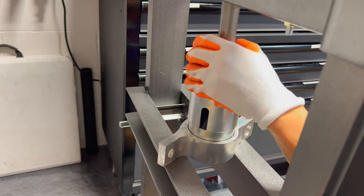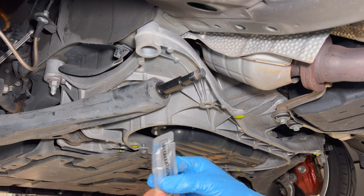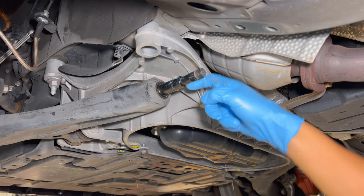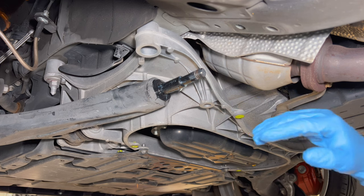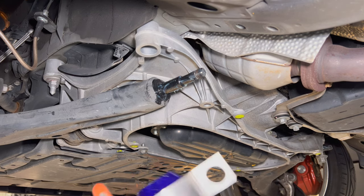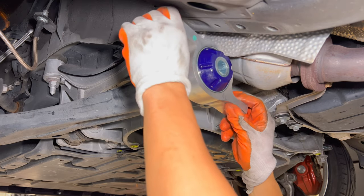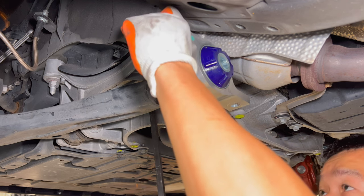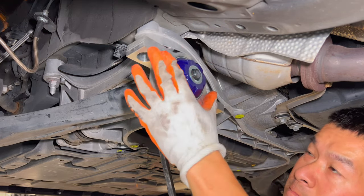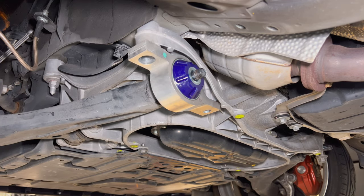We'll go ahead and do the other one on time lapse and get this thing back in the car. The first thing we want to do before we get everything back together is use the installation grease and just grease the whole area where the new bushing is going to go - get it all around the little piston. We're going to have to pry it back down, stick the new bushing back on, and just pry it in there and squeeze it in. Make sure you grab the right one - the one you marked. This is the left rear side, so I've got the RL. Let's slide this thing on. We know we have a lot to clear to get it through, so pry it out.